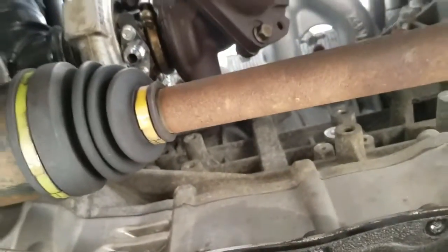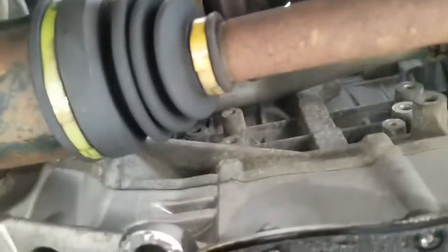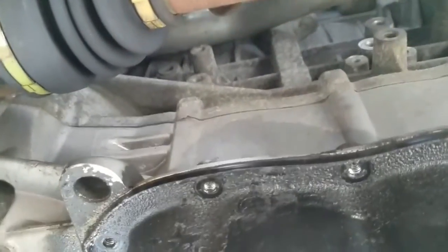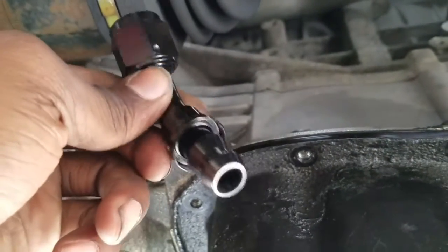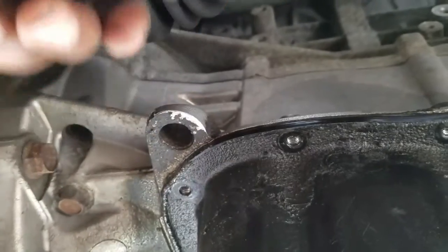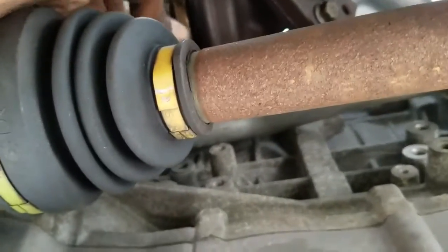All right, now, you probably can't get a good perspective of it, but as you can see, the oil drain comes down and the CV joint is in the way. My bad, the steering column. It's not the column, it's the whole axle of the front wheels. Yeah, so this is in the way. So, what this is for, this is an 8AN, I think it's an 8AN 45 degree push on bung fitting. So it would go here, right, and you would screw it on.